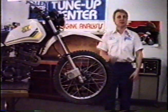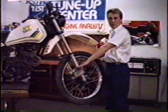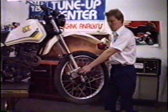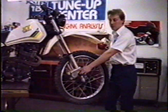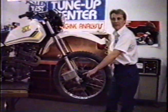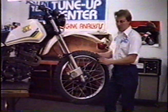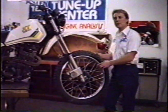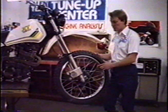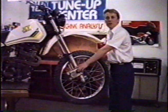An out of balance wheel is a real handful when it's spinning, especially if you have a gyro motor on the front of your bike. My gyro motor is a Jabsco bilge pump motor that you can get at any marine store. I have it connected to the front wheel by a 25A chain that I got from Chain and Sprocket Specialist in El Monte. I'm geared at about a 6-to-1 ratio. Anything from about 8-to-1 down to 4-to-1 works pretty well with this motor, depending on how quick I want to get it up and how soon I want to be under control.